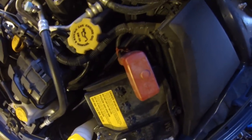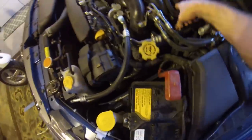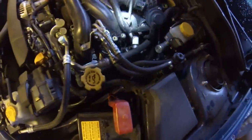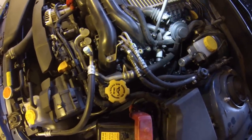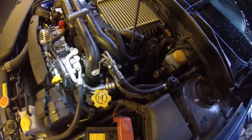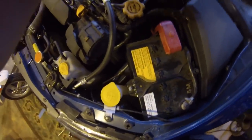There's a little O-ring on the passenger side that looks like it's still on there. I'm going to go ahead and undo this hose clamp to the intercooler using the 5/16ths socket. That was really loose — that thing had no torque on it. I don't know if the last time they did it they didn't tighten it enough.